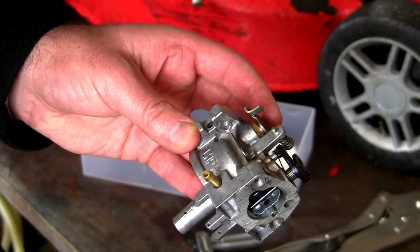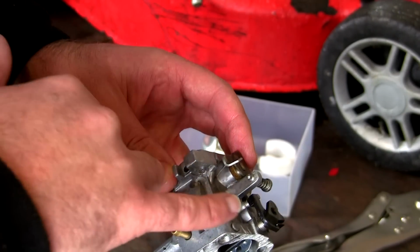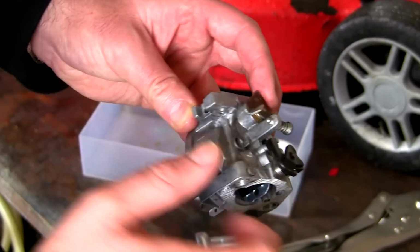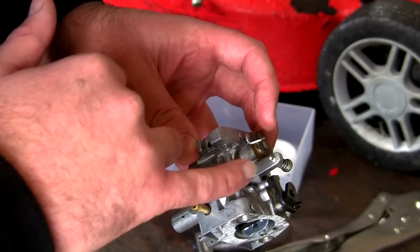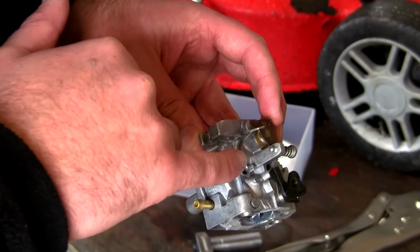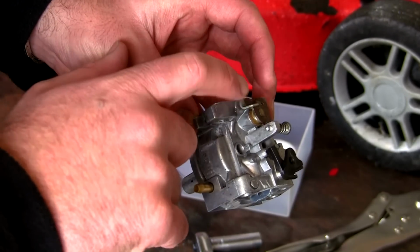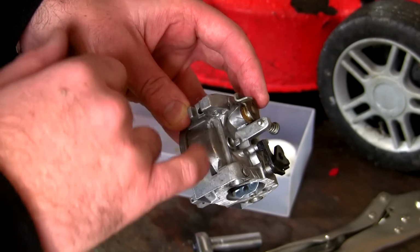I actually had a recent subscriber contact me on YouTube and ask me about where the springs exactly went on the top of this carburettor. The one he had that had failed was this tiny little spring here. Can you see the one that sits under here? It has this little tab that bends off here. That one had failed, so this throttle arm didn't return, and that's what was causing him a problem with his lawnmower.